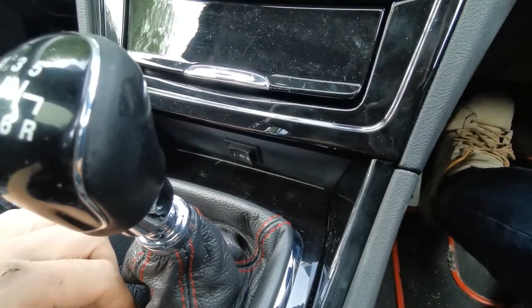Alright guys, it's all working. Zero is front wheel drive only, the first switch position is the intermediate lock - I'm calling it 70/30 - and then the second position is the full lock. Just went up and down the hill and it all works. Put it in front wheel drive and it spins up, put it in 70/30 and it slightly pushes the front forward, and 50/50 is just solid - it just goes. Yeah, successful, it's all working.